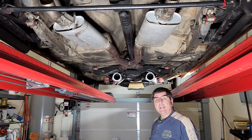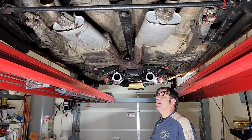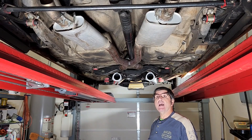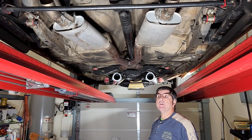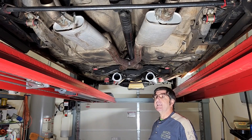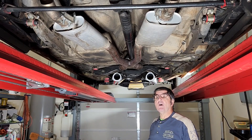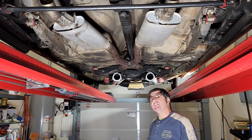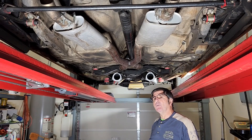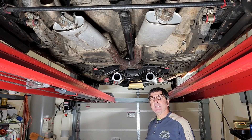I installed a set of TTI two-inch header tube headers on my '73 Charger. I had to wait quite a while to get the TTIs — they were on back order. During that time I had a set of unknown-brand inch-and-three-quarter headers on this car. It's got a 505 stroker big block in it, a 440-based 505 stroker. I expect to see some horsepower gain going from those inch-and-three-quarters up to a two-inch header tube. I expect this engine to be making between 550 and 600 horsepower, probably equal to that or maybe a little more in torque. So a two-inch header tube seems large, but it should be adequate for this engine.